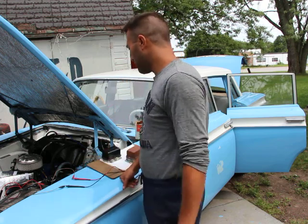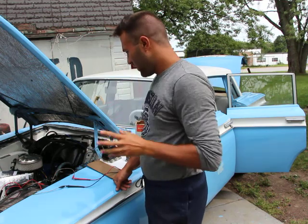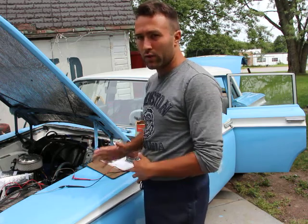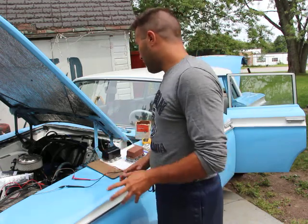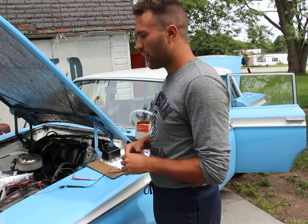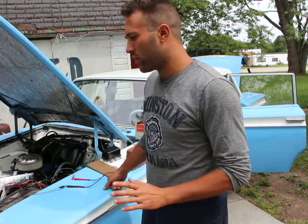So as usual, I'm doing this series of videos because I had a problem. What was happening is the car would usually start just fine when it's cold. The engine cranks really well, the starter cranks really well. It's a new starter, by the way, so I know there's no problem with the starter. The generator was fine, the voltage regulator is fine, so I'm suspecting it's a bad battery. But what's happening is the car starts just fine, and then if I drive it for 20 minutes and try to restart it, still hot, it will struggle. It will not start and go.